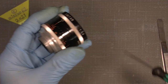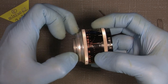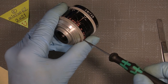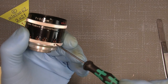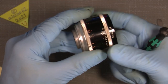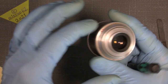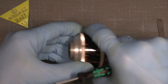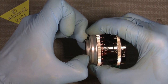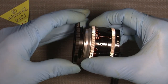Now let's jump into it. When you have loosened the three screws, you pull off only that part here — it will come out with the thread. Don't move anything. Just loosen the screws a few turns — not necessary to unscrew them fully. They have to sit flush with the focusing ring. Now everything is ready to take it off gently. We have to wiggle a little — sometimes it's good if you have an adapter like this one here.